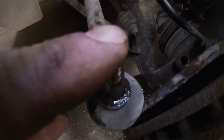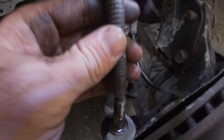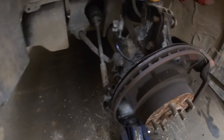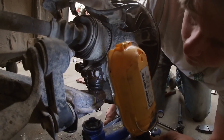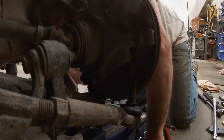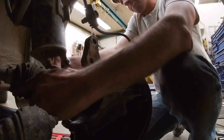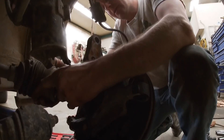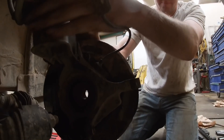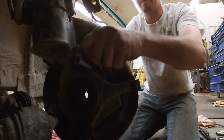I put the punch at the very top — I don't like hitting the top of the threads, and that has a castle nut. I don't like tapping castle nuts because they get deformed easily, so I just used a punch to knock it out. It came out with a few solid hits. This is that pinch bolt I was worried about breaking — giving it a good look over, a few more taps, and a little bit more lube. I want to get this axle out of the way so I don't mess that boot up with the flame. I slid it back into the shock tower and put the two bolts back in — not tightened with nuts, just to give it rigidity when I go prying on that pinch bolt. Took out the ABS sensor — anything that's going to be messed up by heat I wanted to remove.